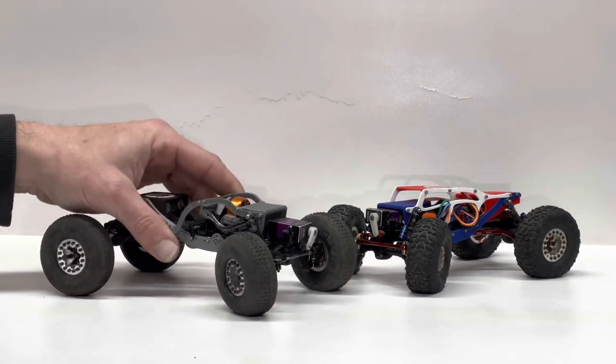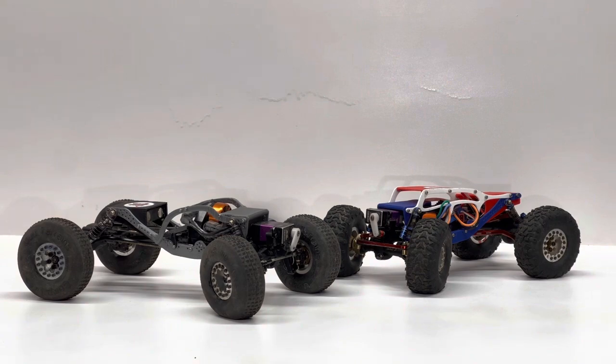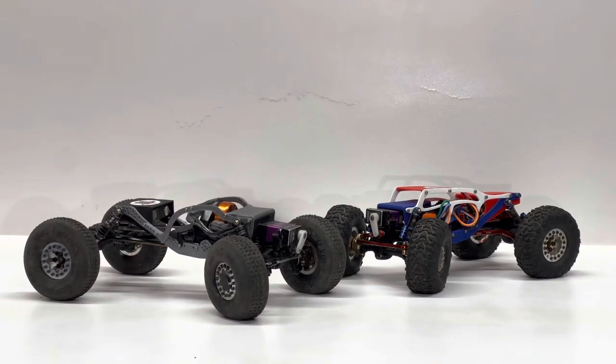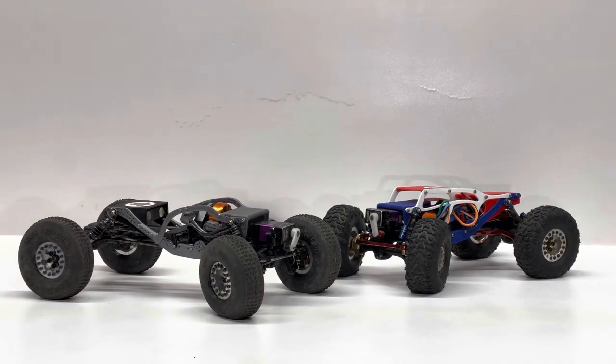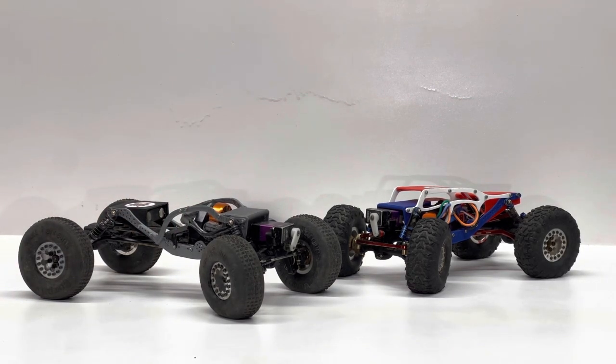In this video I'm going to show you some clips of the progression of figuring out how to make this chassis stiff. I ran it with the cage for a while and that helped stiffen up the plastic rails. When I switched back to mounting a body I missed the stiffness — these plastic rails are really flexible — so we made these struts. You'll see a couple of different runs progressing from no struts to one progression of struts and then a final strut configuration.